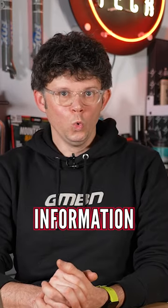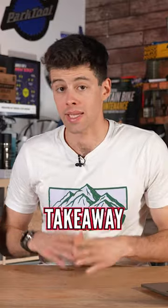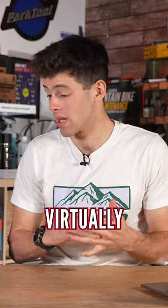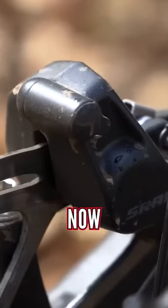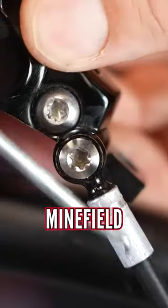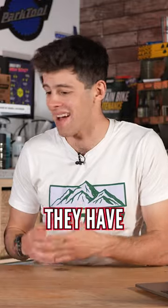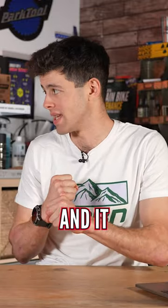Everyone's quite coy with this information, but the key takeaway is that the rest of the fittings mean it just won't be okay, because virtually all of these hoses have factory-fitted banjo bolts now, and that is an absolute minefield of compatibility with the calipers. Even within specific models of specific brands, they have different banjo bolts and there's slightly different holes, so it just won't fit.